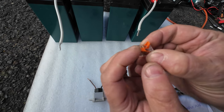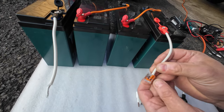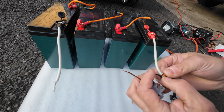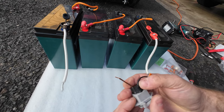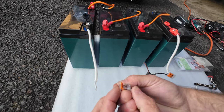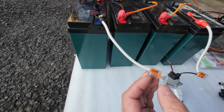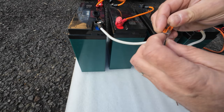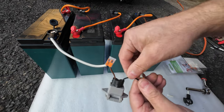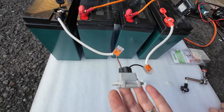You open one of the connectors and the second one. You put one wire in one hole and click that lever down. And then you put your second wire into the hole next to it, and that's it. It's going to connect those two wires. Now you do the same with the second connector. Open up. Lock. And insert and lock. Test if nothing is loose, nothing is coming out. And here we have a quick setup that you might be using for the next couple of years.